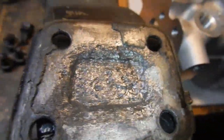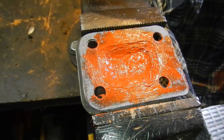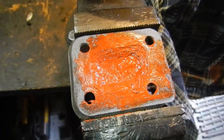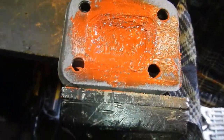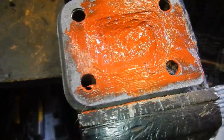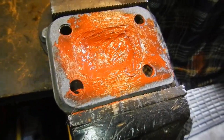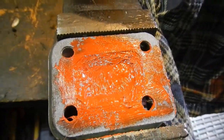Because I'd catch it if it started leaking. Unfortunately I could not find another good plate to go on the back of the head. So I spoke to the customer about it and said look, I can seal it over with gasket maker just to seal up the affected areas so it doesn't get worse hopefully. So he says all right. So I've done that, then put a gasket on and resealed it again. That should hopefully last another five years or more. I'll keep an eye on it every service, and I can change it with it in the van if I find another one. Or if this one becomes a problem I can get one made - just a flat plate with four holes drilled in it. But this will do for now.